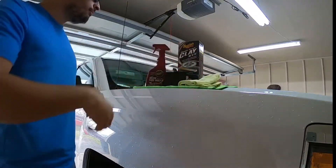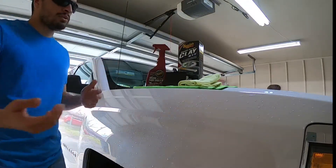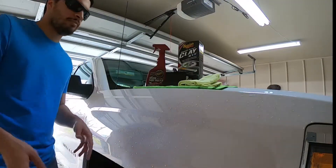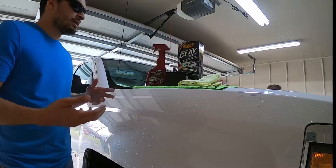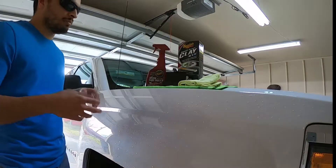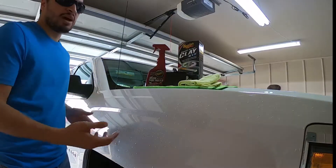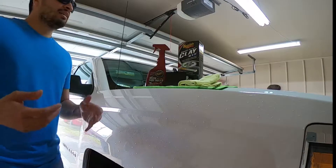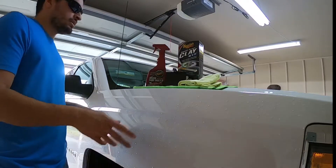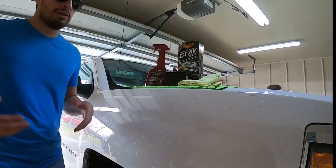It's not bad. But what a clay bar is — if you don't know — is just when you think your paint's clean, you just washed it. I just did an ONR wipe down, so I removed all the surface dirt that you can see. Well, as you'll see when we use this clay bar, it's gonna be shearing off whatever the embedded contaminants are. I'm sure I've got a lot of paint overspray — we got a tractor shop, we paint everything red. If this panel is like the other panels I've already been doing this morning, the clay bar is almost going to be completely red after just this one panel. There's little dust particles of paint embedded into the paint, and there's gonna be iron particles and other stuff too.